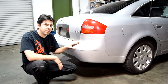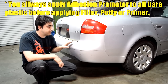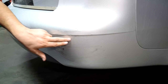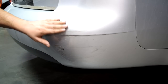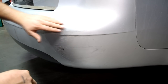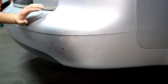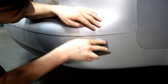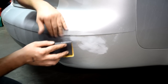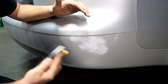Also, if you're going to apply some filler to your plastic bumper cover, it's a very good idea to look into buying some adhesion promoters and apply that before you apply your filler. Now let's get on with our repair. Since these scratches aren't super deep, I'm going to start off with some 220 grit sandpaper and go over all of these scratches and scuff marks and try to smooth them out as much as possible. If they don't smooth out with 220 I'll go one down, but I think 220 should do the trick. When sanding around these edges, you don't want to sand directly over the edge because you'll dig into it quickly and once you're done spraying it's not going to look good — just sand the top part separately from the bottom.